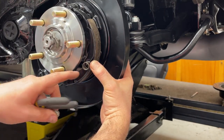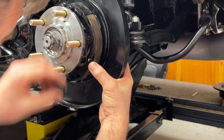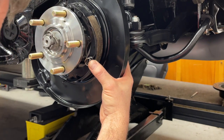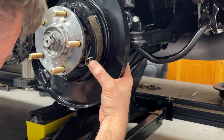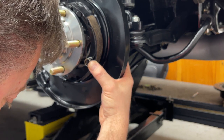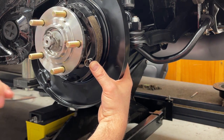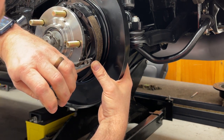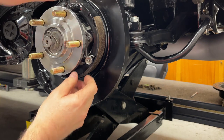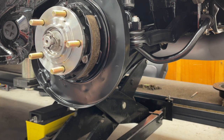There's a spring that goes in between the brake shoe and the hold-down clip. This is where I use the needle nose pliers. So this is going to be the easier one to do because you don't have everything all lined up right now just to get this in. And that clip went. So let's grab the next clip and we'll gather that one for when we do the other side. This is why people hate doing this. Of all the things people invented to make things easier, I don't think this was the best design. My opinion anyway. There. Okay, that's in. Got this one in. We'll put it where it needs to be. There. That side's in.